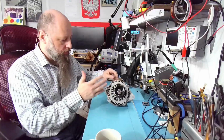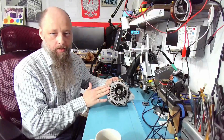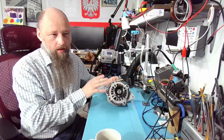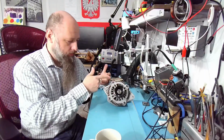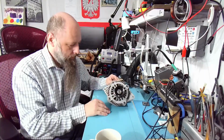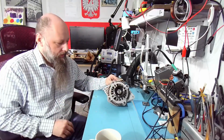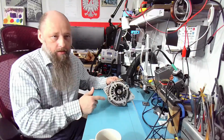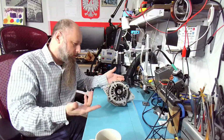Well, we don't need to, or maybe let me put it this way. There is a reason why the alternator failed, and there could be a few reasons. One, the alternator was faulty, poor build quality, and we'll see. Maybe one of the diodes doesn't work anymore. One of the diodes went faulty. Maybe the windings. Maybe the commutator is dirty.